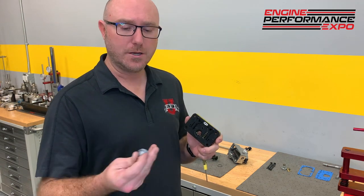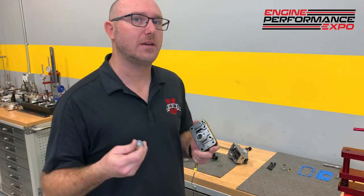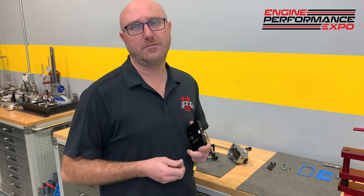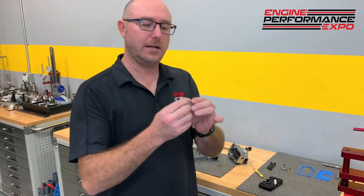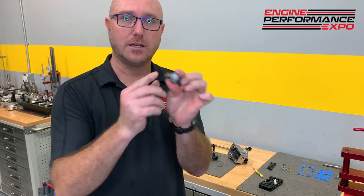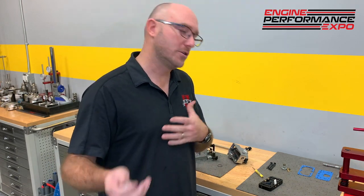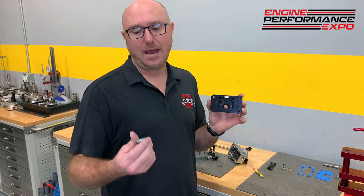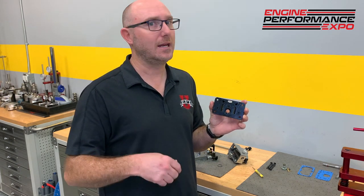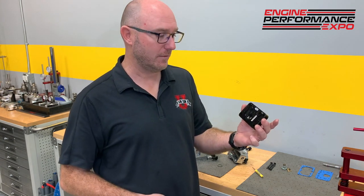You're really not, because it's the size of the orifice and the power valve channel restriction that controls how much fuel you get. Your power valve, for example this one's 5.5, means that whenever the engine vacuum is below 5.5 inches, meaning when you open the throttle, that's when this spring-loaded vacuum-actuated circuit will open, and at any manifold vacuum below that value, it'll supply fuel from the circuit through those channel restrictions. But having a bigger or a smaller number on the power valve is not going to give you more fuel, just earlier or later delivery of that fuel.